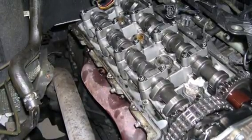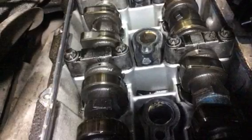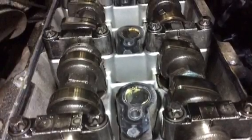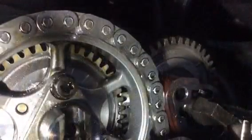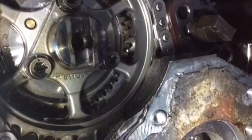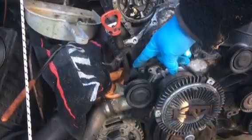Here we've got the cam cover off, and cams are revealed. 2 little dots you'll see. Keep them lined up with the shells. Those shells just come undone. Start nice and methodically and gently releasing them. And check also, you can see in the middle of the picture here 2 little markers, 2 little holes. Look where the 2 teeth meet of those 2 cam cogs. Make sure they go back together.